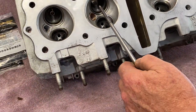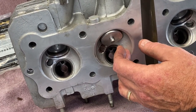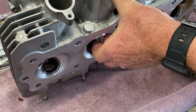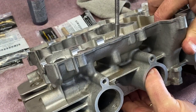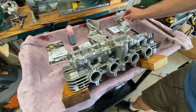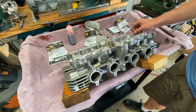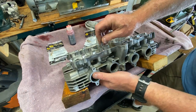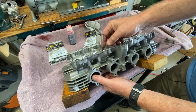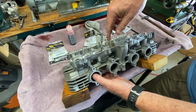So we're going to do number two intake valve. We carefully shove it through the big hole where the valve guide sits — you can see it sits right there up against the valve face. We lean it up like this on some blocks of wood. The next step is to put a valve guide on, so we use a little assembly lube on these — which is what I read is supposed to be used on the bronze ones; you don't use any heat. We slip that over and drop it down. Because of the tight tolerance on that disc on the 7mm shaft, it will help keep the guide concentric with the center.